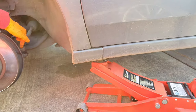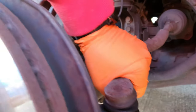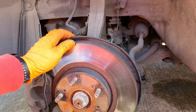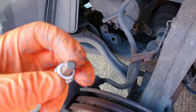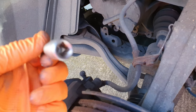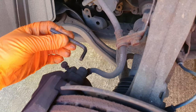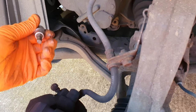I'm doing the tie rods, which are these here, and as you can see mine are really bad. I'm also changing the brake pads. Before I go further, I want to show you this: get one of these — it's a 7mm allen key, but this one has a quarter-inch socket attachment. If you use a plain allen key you won't get enough leverage, which is why the socket version is much easier.